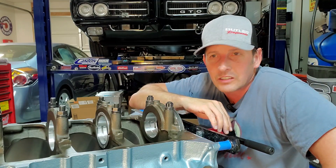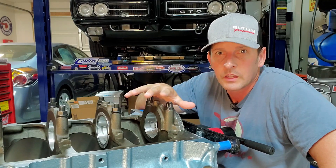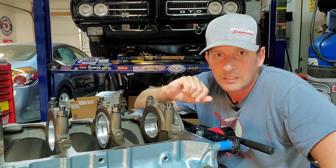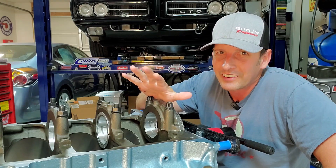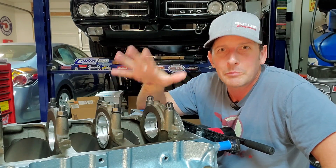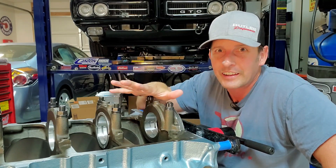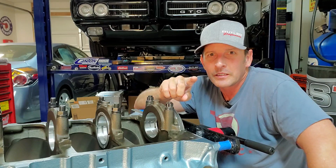Now that we're here — if you missed last episode, we checked the oil clearances on the main bearings. Today we have to test fit the crank. We're also going to test the measurements using plastigage, and assuming that goes well, the next step is to officially put the crank in the block for good, because I don't want to take it out ever again.